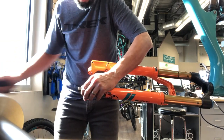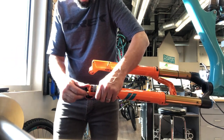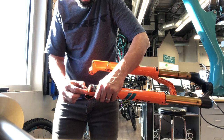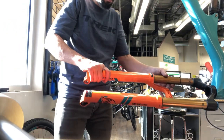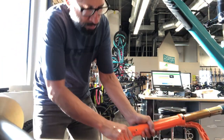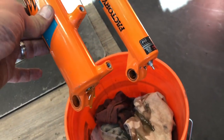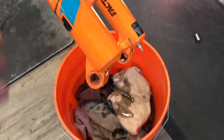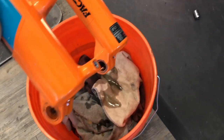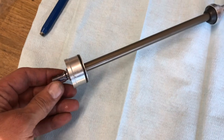Be careful — aluminum nut, aluminum thread — so it usually just takes a couple smacks until that's freed up. Then you can pull your lowers off. There's quite a bit of oil in there, so pull them off just a little ways to let the oil drain. I'll usually just drain them off into a bucket with dirty grease rags. Gradually lower it down to where it's pointing vertically — it drains out pretty nicely.